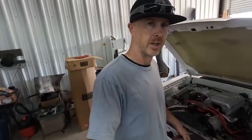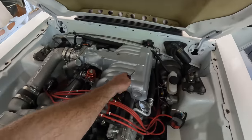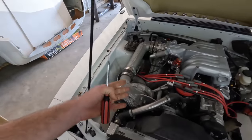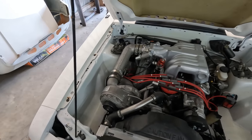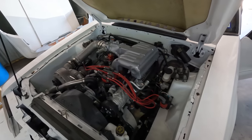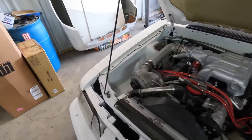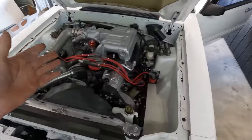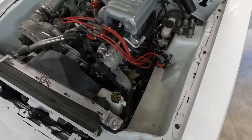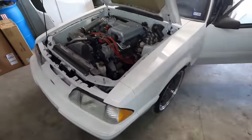So if you look underneath the hood here, got a nice small block, Cobra intake that's been cut open, extrude honed. We got the old school Powerdyne blower. I'm not sure what the internals are, but we got Aeromotive rails. We got a whole bunch of nice aftermarket upgrades here, and it's actually running on a Holley Terminator X. Shaved out engine bay. One interesting thing about this car, it was actually a Coyote swap car, I'm told. You see the sway bar mounts have been chopped right off. We got the poor man's wire tuck going on here, and pretty solid little car.